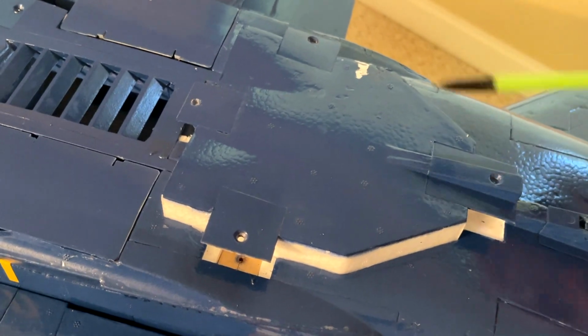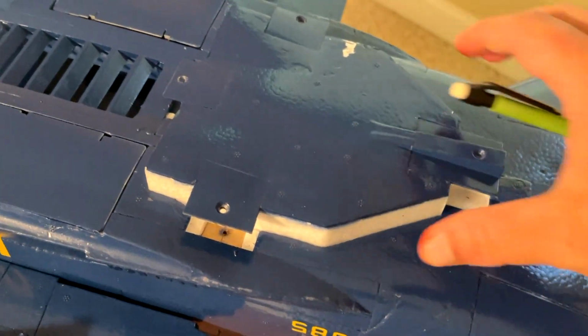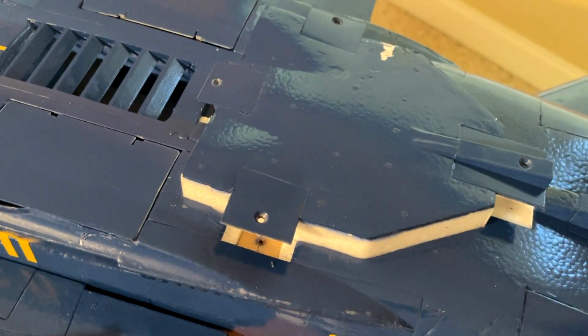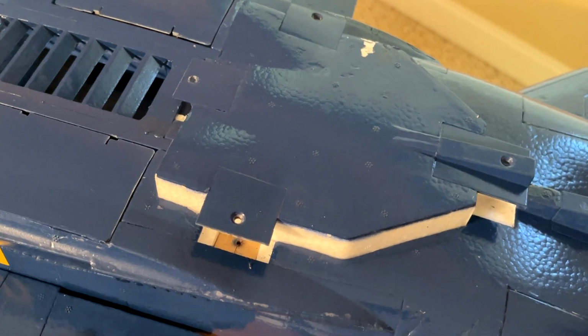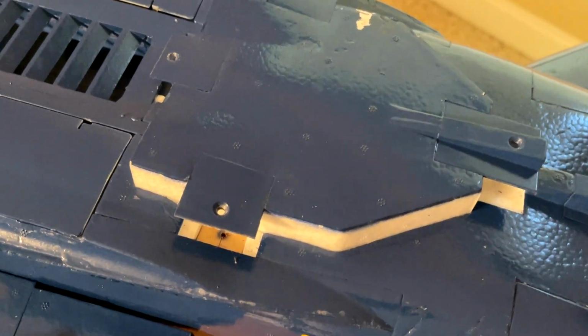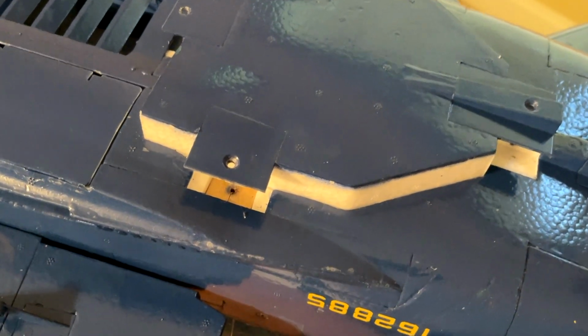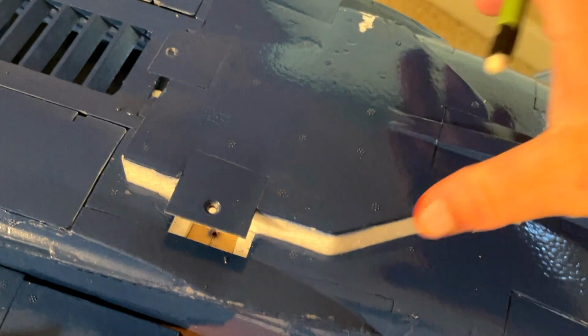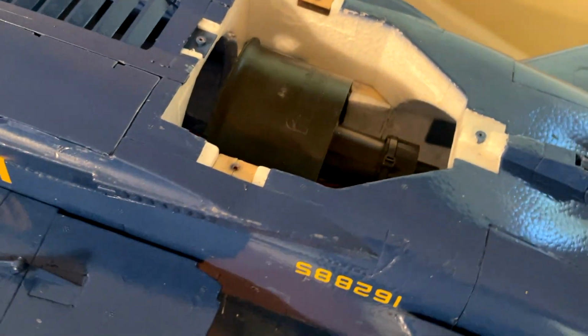First thing we do is remove all the hatch screws. This one's got 4, so 1, 2, 3, 4 we've already removed. And then you want to work this up a little bit at a time. If it's the first time you've ever removed it, you've got to be a little careful because it is going to be on there fairly tight, and you don't want to just lift up on one panel because these are glued in and the mounting tabs can come undone. So you work it up a little bit at a time until you put your hand on both sides, then you'll just lift it out.